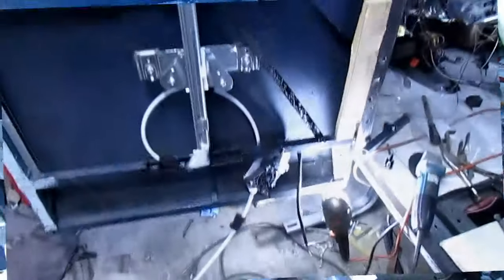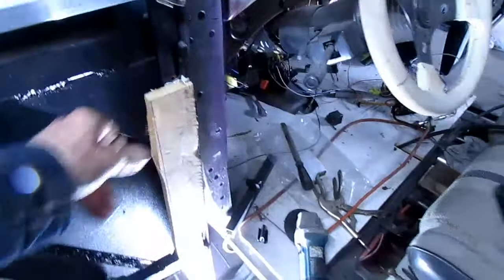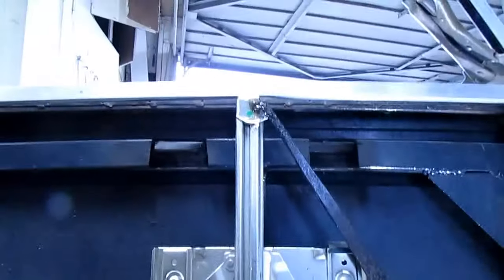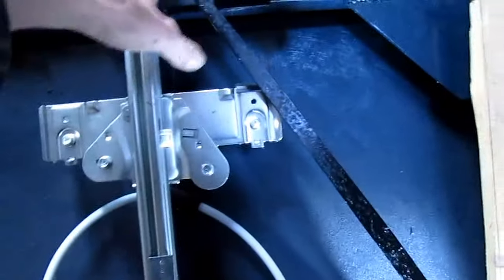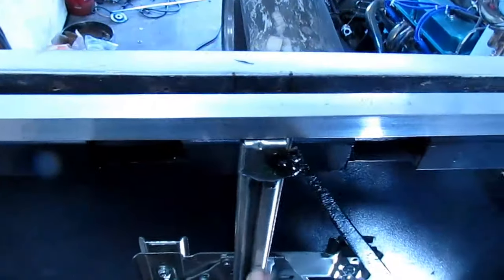I did quite a bit more on this. I put this board in here — that's good and solid. I got this trimmed up and put exactly in the middle. It's welded here on the bottom. I got a good eighth-inch piece of steel in here for a brace. So the track is good — it's an inch and a quarter from the outside to the center of the track. The windows go up and down straight.